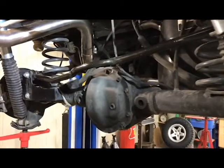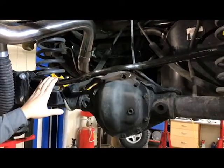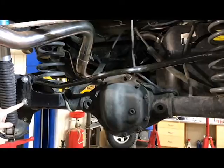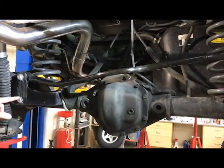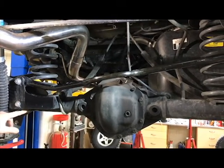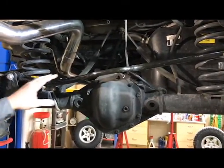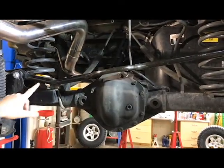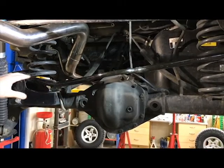The real highlight of this kit is the rear track bar assembly. It's something that most every other kit ignores, but it's super important. The factory track bar location is all the way down on the axle tube — it really should have been higher from the factory, but they chose to do it the least expensive way. This bracket actually raises it up four full inches and they give you a new modified rear track bar with bending to get it in the proper position to the roll center of the vehicle.